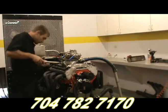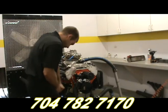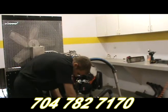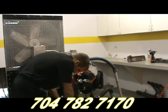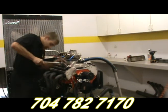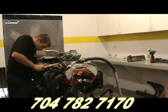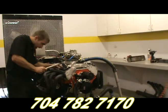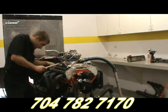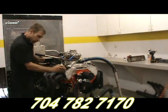You might as well grab your magnet. Let's get our air hooked up here. Sometimes we'll have to tap the top of this, and it's loose so we'll grab our magnet and just go ahead and apply good pressure, get it down — and there you see we've popped one lock. We'll also get this other one out of here. Now at that point, just slowly release it, lift it up, and swing that out of the way and we'll be able to remove our spring.